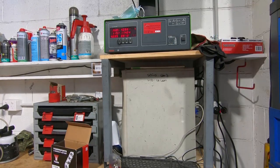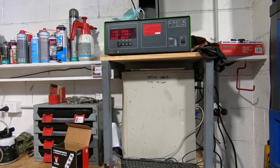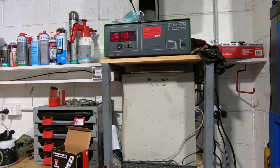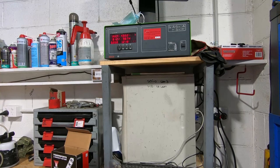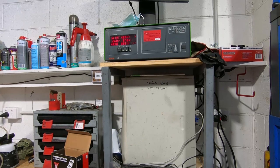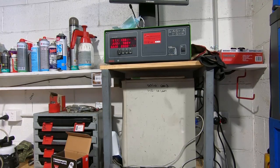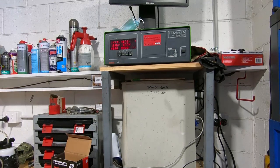So we'll go to the vertical cylinder. We'll see what the vertical says. Because the idle trimmer is at zero, it's a nice base setting to have. So if you can keep it as close to zero as possible, that's theoretically good. But again, you just give it whatever it wants. About 4.9%. What we can do is open the air bleed a bit more on this cylinder and it will lean it out. So we'll try an extra, maybe a quarter turn of air bleed.